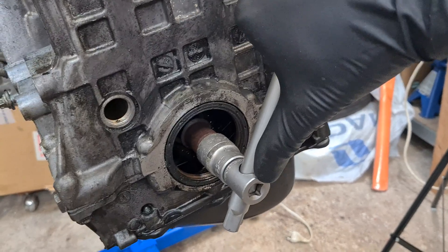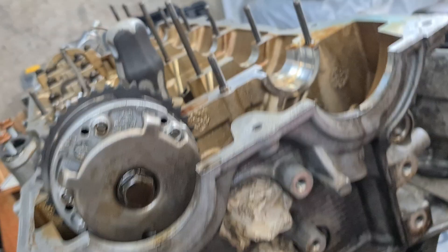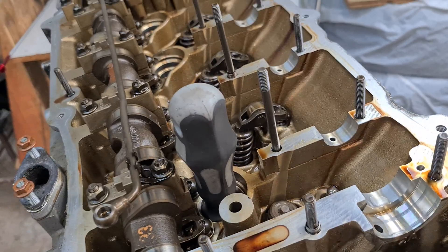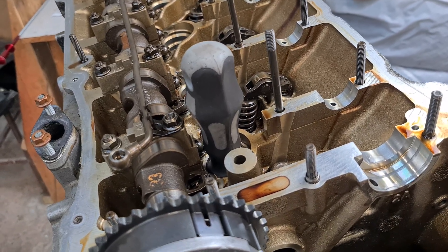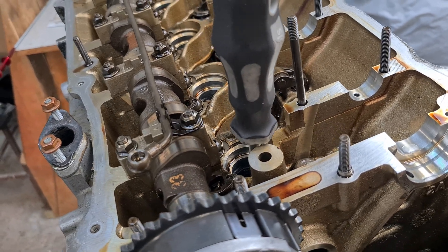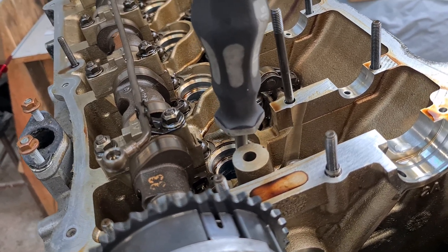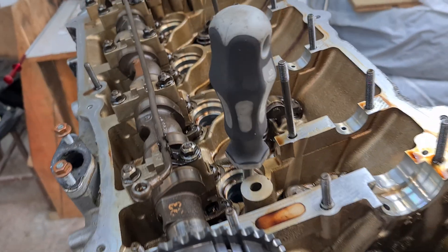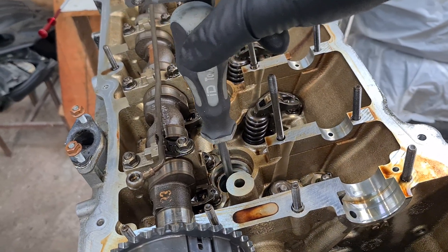So I'm going to rotate it and observe at the top when the screwdriver is in the top dead center position. When it starts to move back I know it's at top dead center, and you don't have to be very precise — this should do.